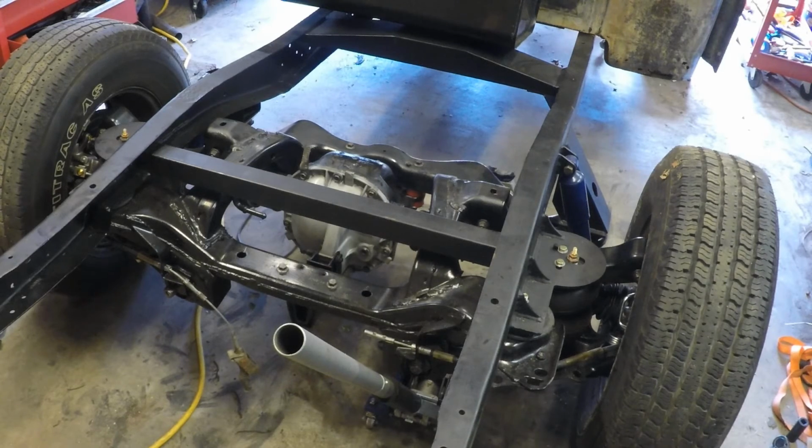Hubs have been quite the adventure. Suggestion, if you're doing this, well, here, let me tell you the reason I really had these drilled. I don't want to change and go to aftermarket brakes. Why? Well, this thing's not a racer, and two, rear brakes get used relatively small with a good proportioning valve, small amount, and aftermarket brakes, they're not cheap.